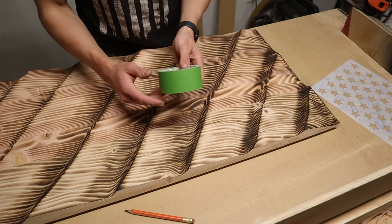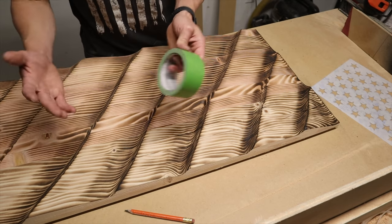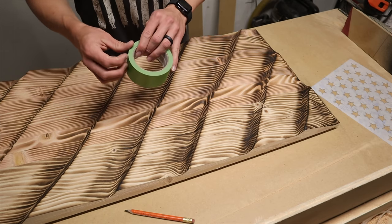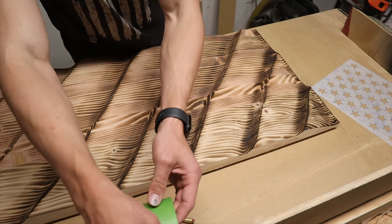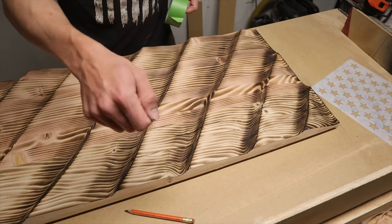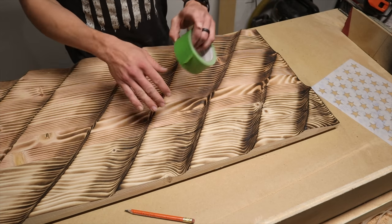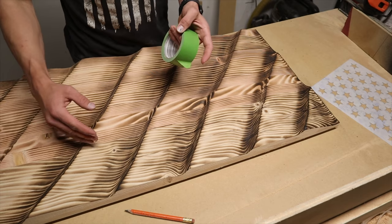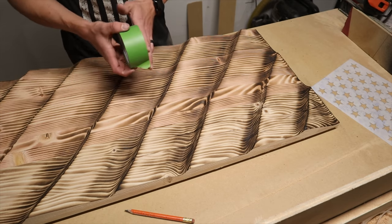And then one more thing real quick that I forgot to mention. So these stripes should be an inch and a half. And then with the 1.8 inch tape, what I do is just pull out a long enough piece, and then I'll tape it to something, and then I'll pull it all the way out, and then I'll just cut it in half with my razor, and then I'll have two straight edges. So I'll just put one on either side of the stripe, and then it'll overlap in the middle. So then that way I'm not wasting a bunch of tape.